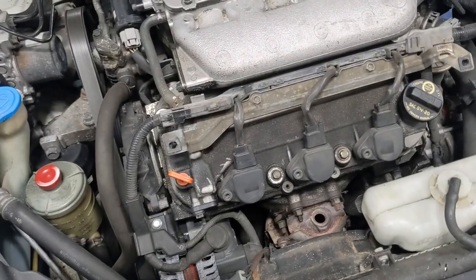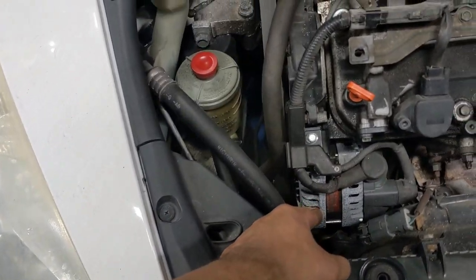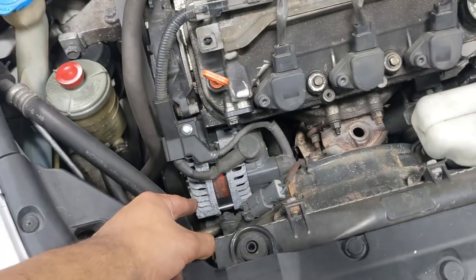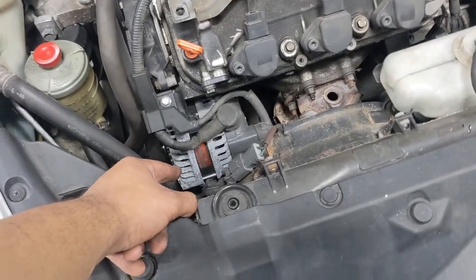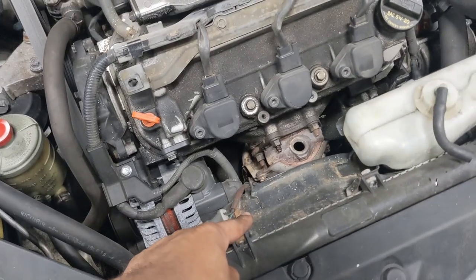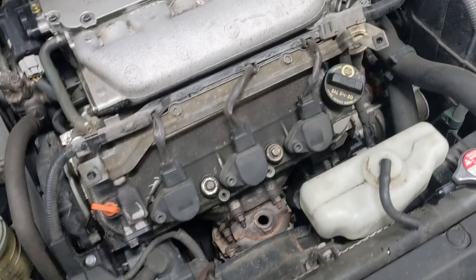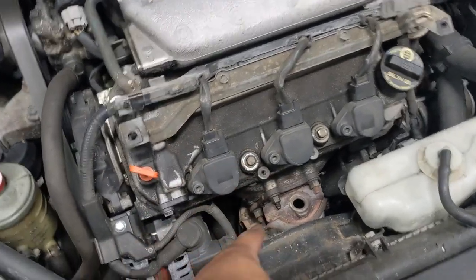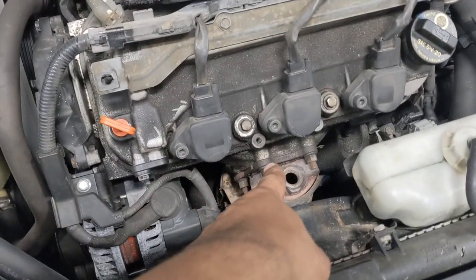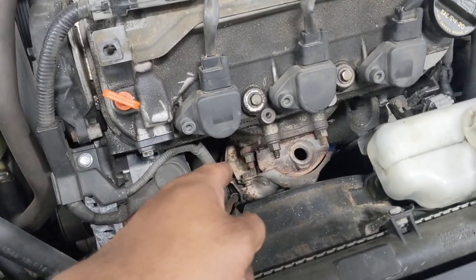As far as my plan of attack goes, I think I'm going to do the same thing I did when I replaced this alternator a few months ago. I'm going to take the fan out, take the overflow off, and then I should be able to slide it up and down. It's just the four bolts on this flange going to the manifold, and then there's three bolts holding it to the J-pipe down below.